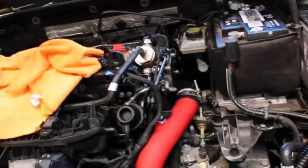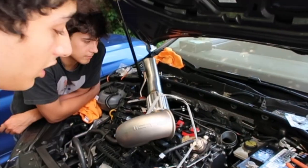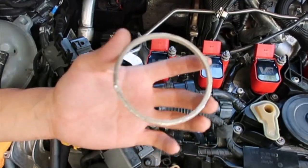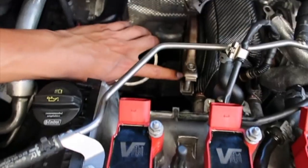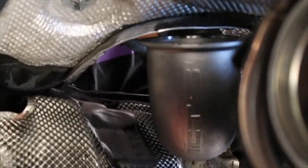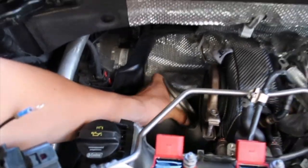Downpipe is the next step. We have everything in — the only thing missing is the intake and the blow valve. Let's go. I'm gonna go from the tail side of the pipe. Make sure you get the old gasket out of the turbo, put the new one in. He's down there — coming through. Such a good view.